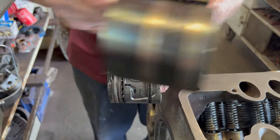The cylinder walls should be cleaned with hot water and soap — the soap gets all the fine shavings out of the pores after boring. When done, I take a paper towel, put a little oil on it, let it sit for a while, then clean it with the paper towel and I'm ready to put the pistons back in. As for center-punching the lifter gallery holes, I point the punch and center-punch each spot, then drill them with a small bit. It's fairly easy to then get in there with the Allen wrench and feeler gauge to set the valves.